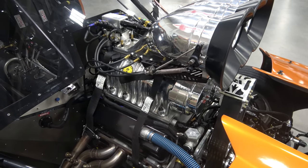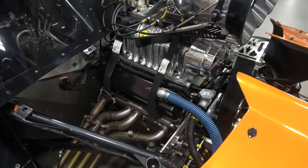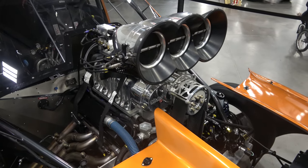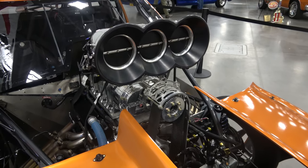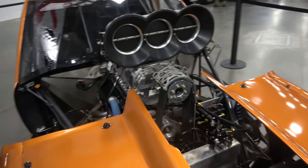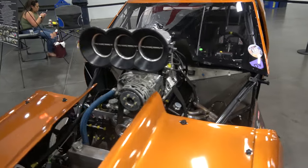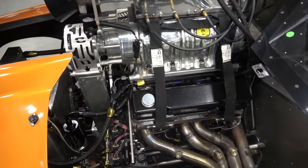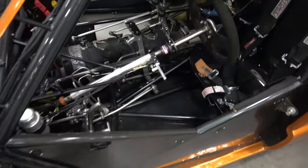That's a beast. So this is a 355 cubic inch short deck, 30 over 350, makes it 355 inches. It is a Littlefield 871 high helix, 120 degree root supercharger. Right now it's 10% overdriven, makes about 18 pounds of boost at 7,000 RPM. That's going through a billet two-disc clutch and a Lenco four-speed transmission. Awesome. Running on 16 EFI fuel injectors controlled by a FuelTech FT600.